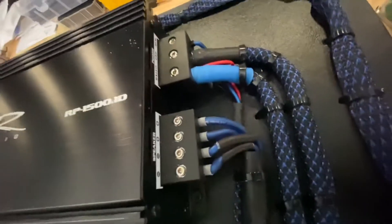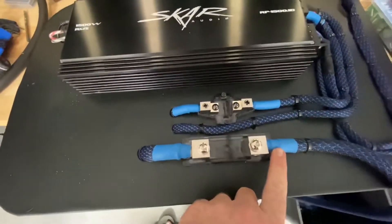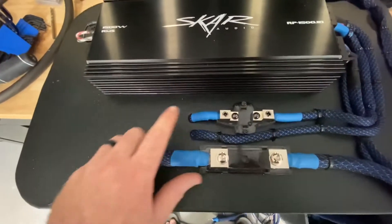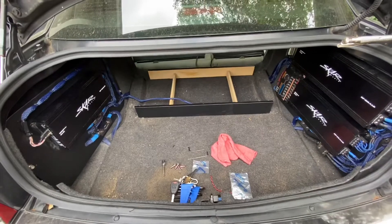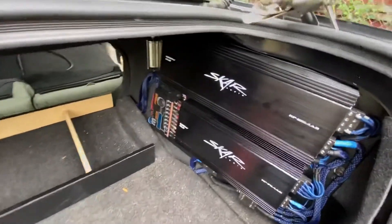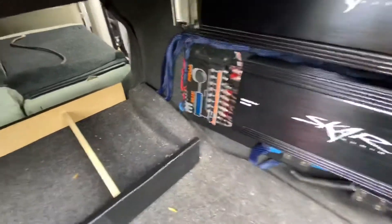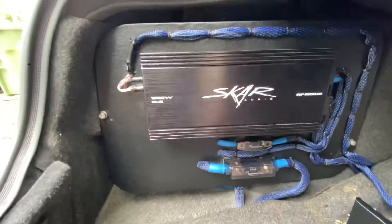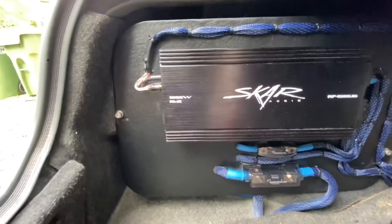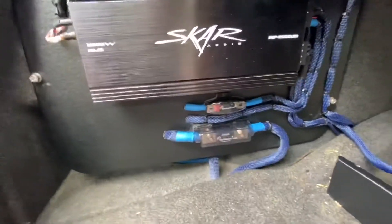Got the amp rack done, wired up the remote, RCAs. We have an additional power and ground going up to a voltmeter on the dash. We have the XP750 going behind this — power coming from the factory battery which is in the trunk, then power going out to the amp and ground going back to the battery. We got all three amps looking good: the 150.4 on the mids, the 75.4 on the drivers and tweeters, the PRB processor, and the RP1500 for the subs. The XS Power XP750 is behind the board with big fuse holders for power from the factory battery and a smaller fuse coming out to the amp.